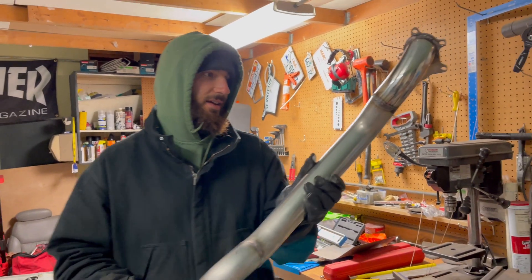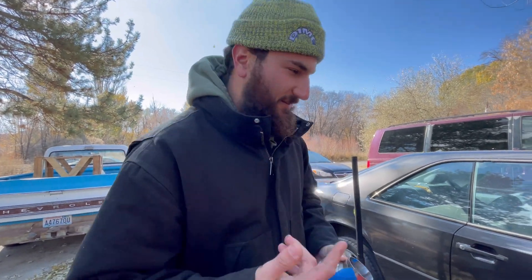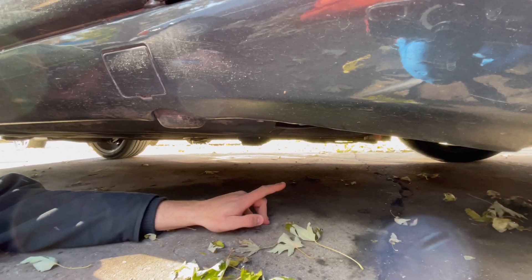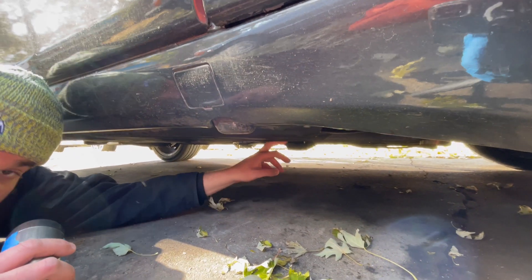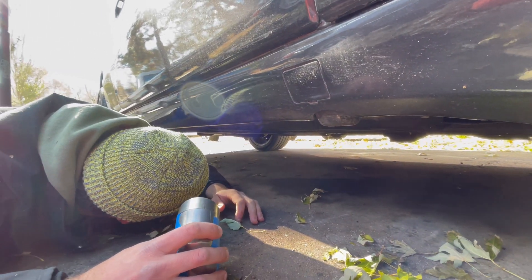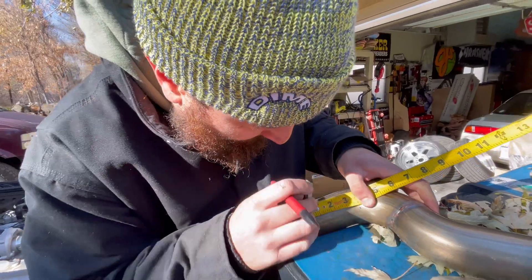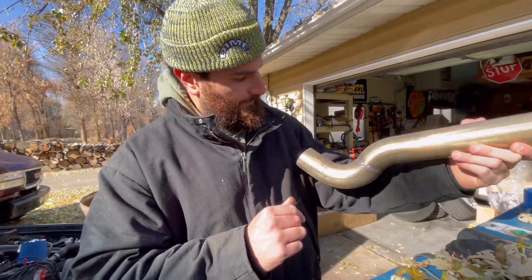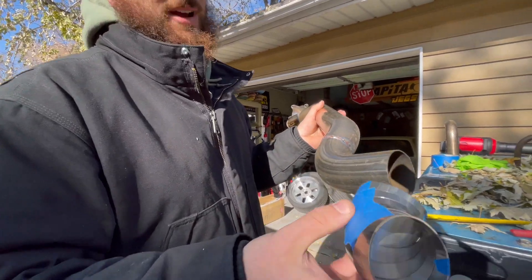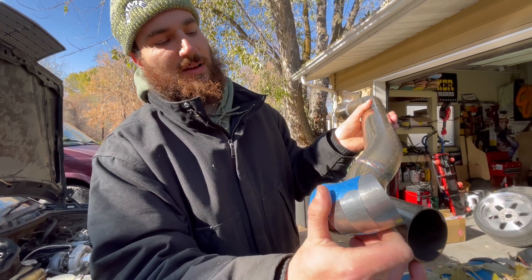From here we'll do a v-band, turn it out v-band exhaust the rest of the way. The exhaust begins at the downpipe — she's pointed directly down, so first thing will be a 90. You can see where she's pointed there towards the ground. Then we have this factory hanger, super hard mount, and we'll run the tube to there and just follow the factory path of where the exhaust ran. There's a cutout under here — want to keep it tucked up nice and high, no dragging, no rubbing. We're cutting a bit to line up with that bracket, accounting for the drop in the 90 so it doesn't sit too low.